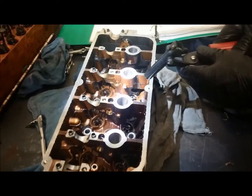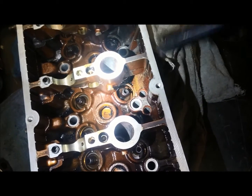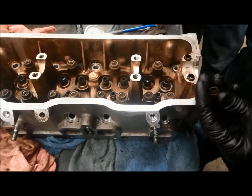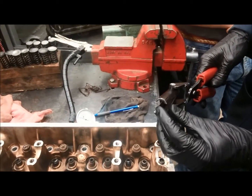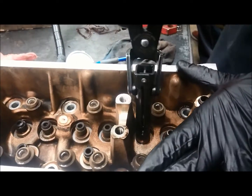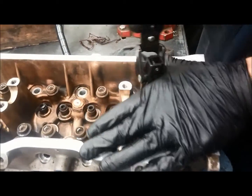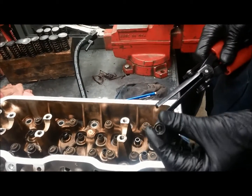In this video we're going to demonstrate how to remove valve stem seals. You can see the valve stem seal down inside of there. This is a valve stem seal that we pulled off of this valve stem here on the cylinder head. To do that you use this pair of pliers — it grabs the valve stem seal right at the bottom, and then you pull. Sometimes you have to pull and wiggle a little bit and it should pull right off.